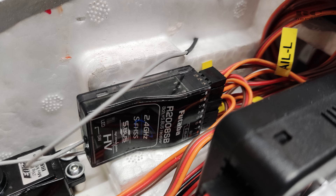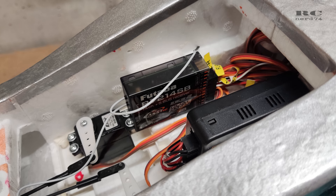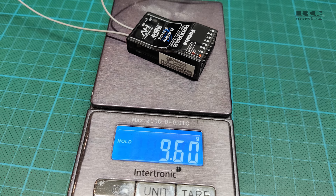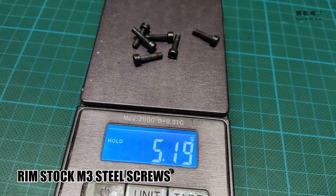The first thing I changed was the RC receiver. On the 8-channel receiver I had no more channels left for additional functions like a towing servo, so I changed to a 14-channel receiver just to get additional functions. The downside is that it's around 10 grams heavier, but it's close to the CG so not a big deal.